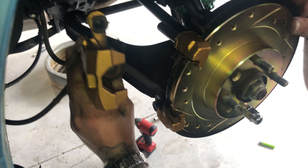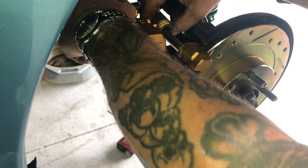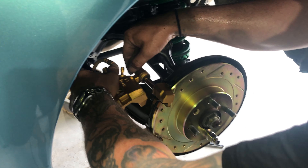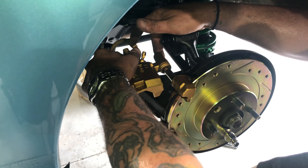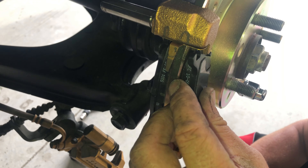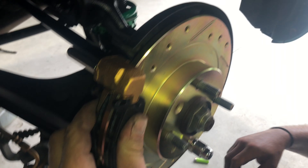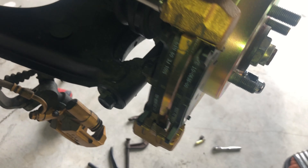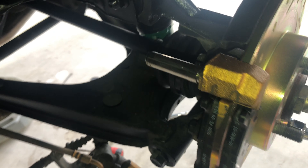There's also a pin up top that the actual caliper swings on. You're going to want to grease that. What you do is pull the caliper up and you can tie it out of the way — we took it off since we were painting it anyway. Then snap the pads back into place. You put the pads in with the main part of the caliper off, just the bracketry sitting there. Both pads are on, and then you can slide the caliper back on using the top pin — just get it greased up.